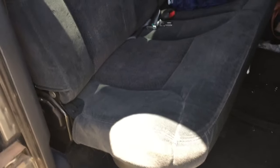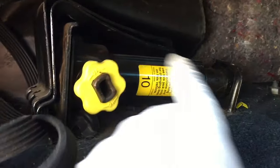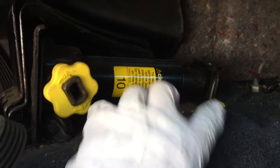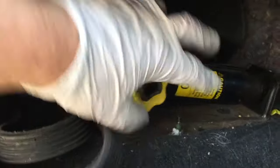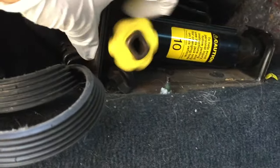First you're going to want to find your equipment for this. It's usually located under the rear seat. There's a little pull tab here that you yank down on and lift the seat up. Here it is under the seat with some instructions on it too. Here's the actual jack, and you'll see it sits inside this little bracket, and by expanding the jack it holds it in place. You can usually do this by hand, and just loosening this up, you'll be able to get the jack out of here.